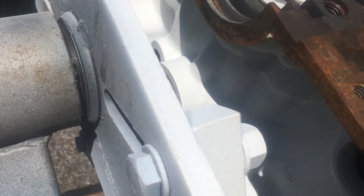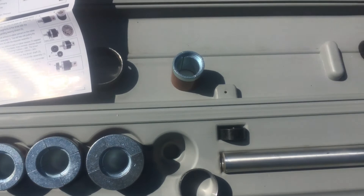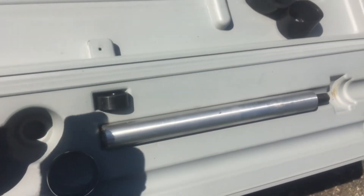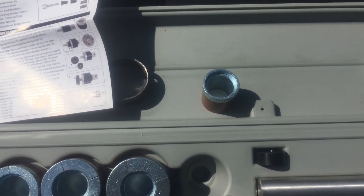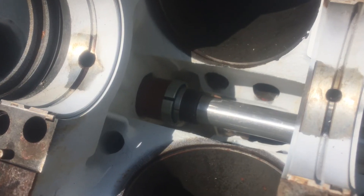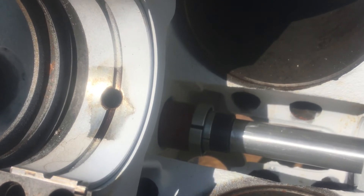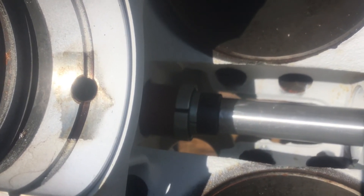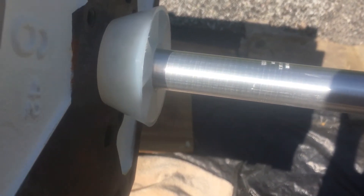The expansion plug is still in there with the bearing, so what we're going to do is fit the correct — number one in this case — bearing driver and drive the bearing out along with the rear expansion plug at the same time, then move towards the front of the engine and keep driving them out. Part of the reason we're doing it this way — you can see it doesn't even go into the bearing, but it helps keep everything centered so we're hitting the rod without it being angled, because you've got this at one end and the bevel at the other end.